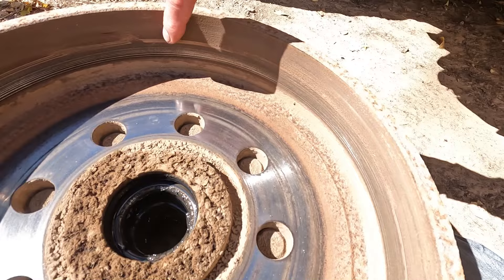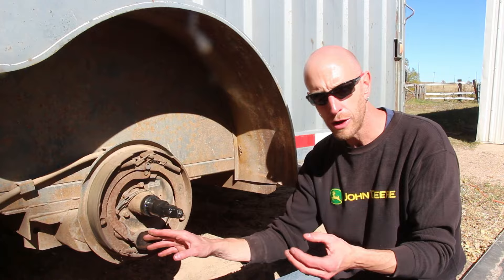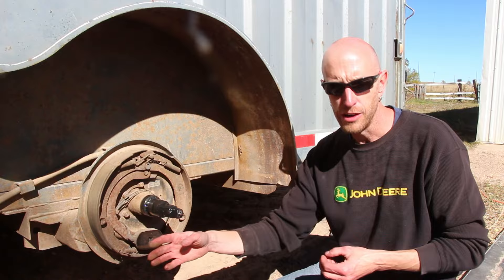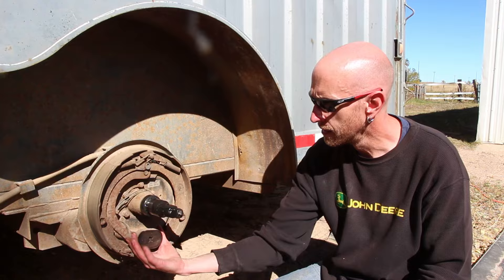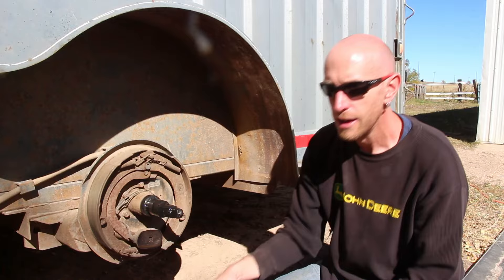Before I tear this apart the rest of the way, let me show you how these work. Down here we have an electromagnet which, when you step on your brake pedal, is connected through the brake controller for the trailer. That energizes the electromagnet depending on the setting of your brake controller — higher setting exerts more force, lower setting less force. This electromagnet will suck to the inside of the drum, and then as the wheel spins, that rotation causes the pads to expand out, pressing along the outer area of the drum. That's where you get your braking force from.